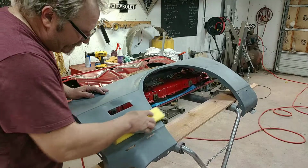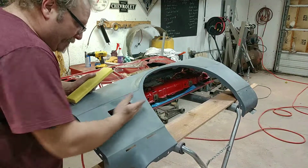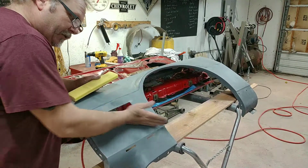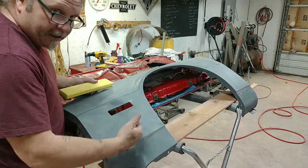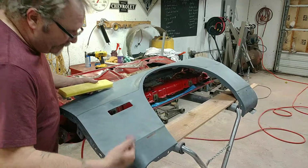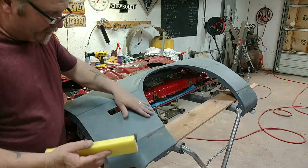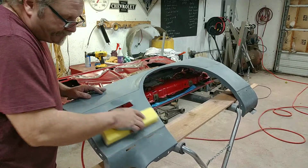The reason is when you're sanding, going like this, you're creating all them sand scratches in one direction. And you keep going in the same grooves, and you just keep going towards the same thing. Now, if you go with an X pattern like this, when you create them sand scratches this way and you start to go this way, you're going across some scratches and you're really digging that material out instead of going with the grain. You start using this X pattern, you start really removing a lot of material, getting that stuff out of there. You can move a lot more material a lot faster, and it makes your panel a lot straighter. You're not working in one spot, you're moving it around, and it just really makes a nice flat panel.